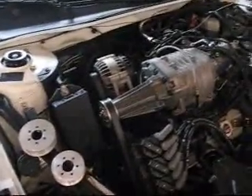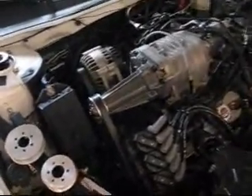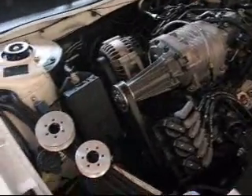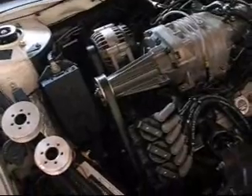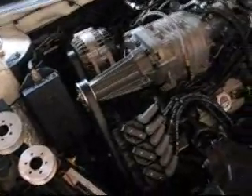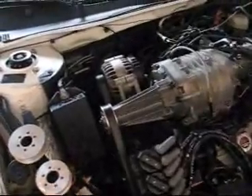A lot of you guys ask what kind of supercharger pulley should I use on my car. First thing I'm going to say is go modular. With a modular system you could swap out pulleys in about 10 minutes. If you go with the press-on you're going to need a pulley puller tool to pull it out each time. So you just use it once, sell it to another guy who needs it, and you never have to worry about that again.